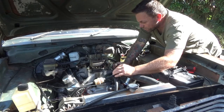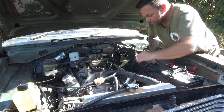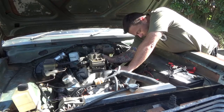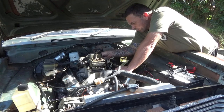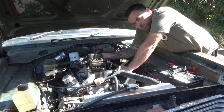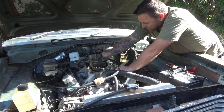It's very, very fuming. I do believe this came out of a heap of stuff that a mate of mine got, and they were all for a fairly worked big block. This could have been a dual carburettor setup for a big block — I don't know — but it's jetted way too big. So I figured the easiest way is just to put this one aside; I'll rebuild it one day. We'll put a brand new carburettor on it and get this thing running nice and crisp.